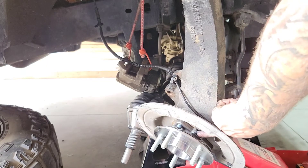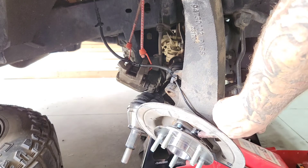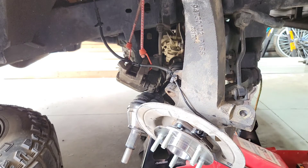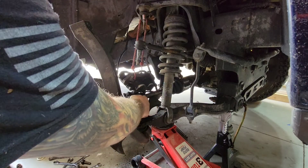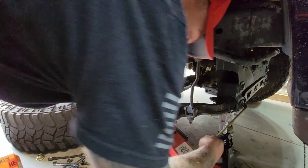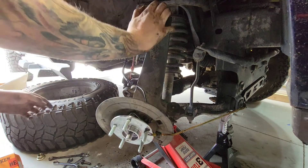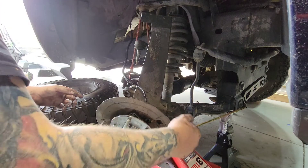Now run everything back — the ABS wire is already mounted on the hub. If you had to torque it yourself it would be 40 inch-pounds, but it should already come assembled. Run the line up, lock it into the clip, run it up, and reconnect it into all the plastic pieces you had before. Then push the half shaft into the hub — for me it worked better to come from a certain direction — line up the splines and it came right through.